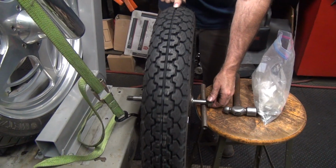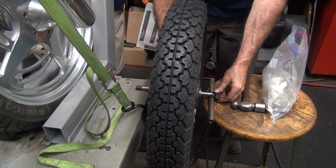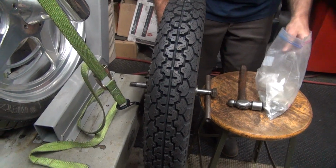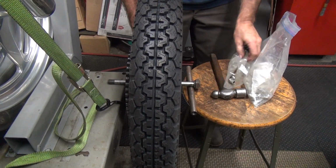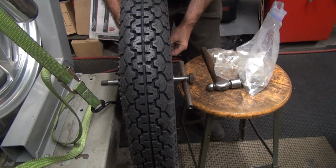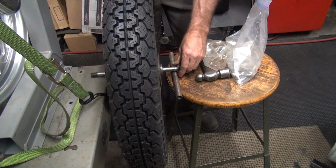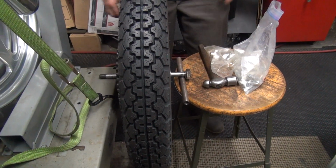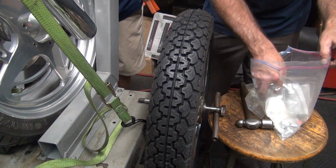It's called gravity. So you put weights up on this side. So you want to know how far off it is? Not much. It's a pretty good wheel then, considering. So we'll just take and grab one weight here. Pretty good wheel. This is probably too much weight, but we'll find out. See, that's a little bit too much.